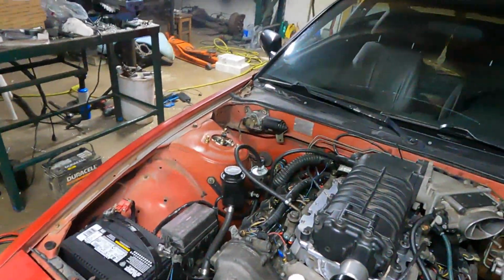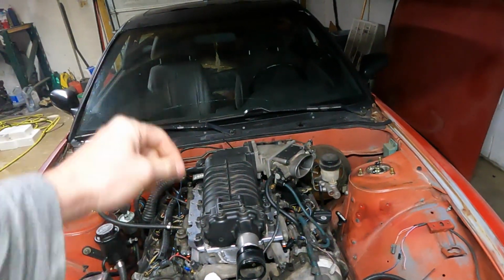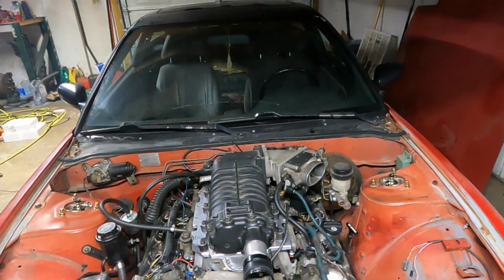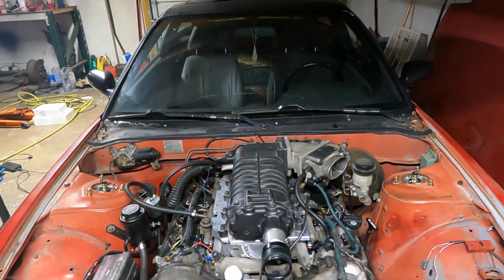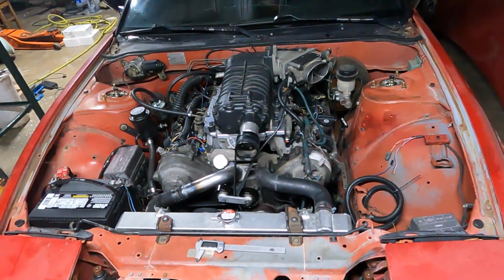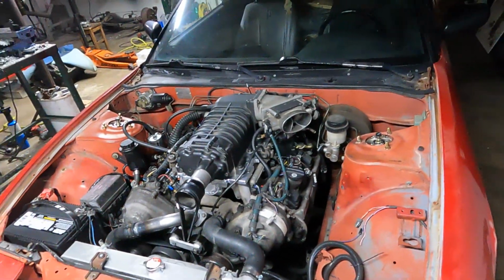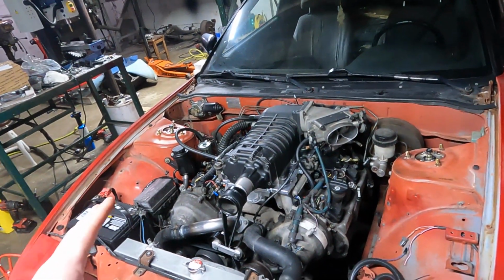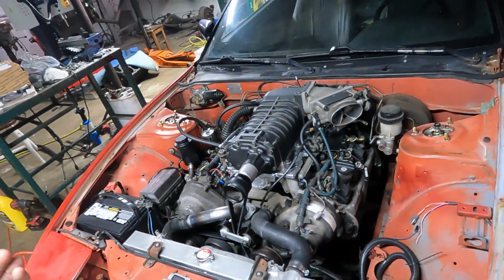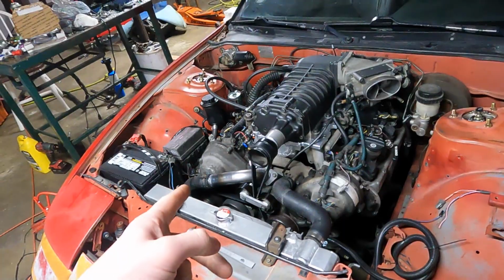I went and drove it yesterday and we're trying to be easy on it right now. I've got the diverter zip tied open. I drove it with it working properly, and this thing's aiming for the moon with boost, and it's not going to do that for too long before it blows it up. These things are good for about 7 psi boost. The rods are real thin, and also it's really hard, since it never had boost, trying to dial it all in at that boost level that quick. Real pain in the butt. So I've got to order a larger pulley.